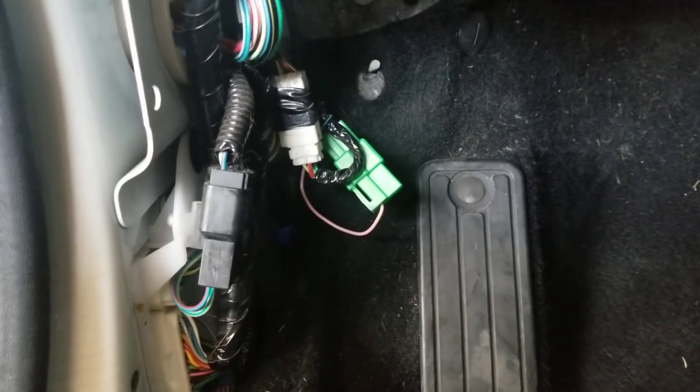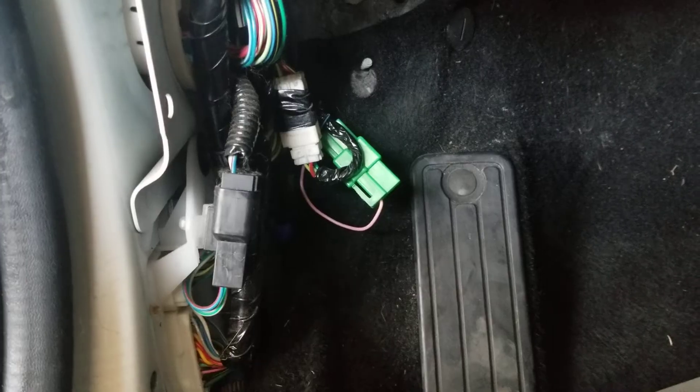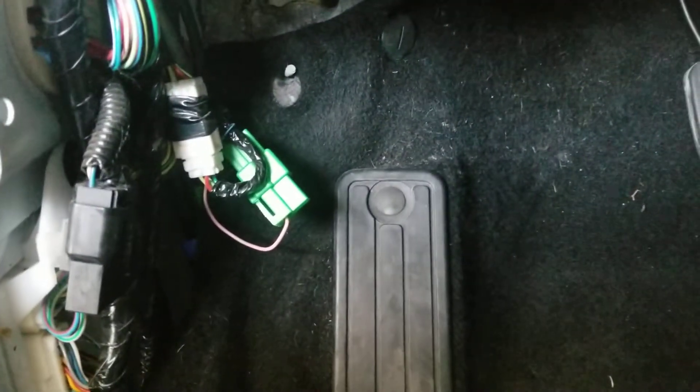They supposedly left it unplugged — its only purpose is for Subaru to perform their self-test, no other issue. Through this mode, the AC fans and radiator fans turn off and will only turn on if the vehicle starts to overheat. Other than that, they will not come on.